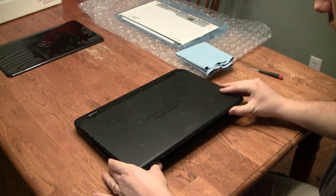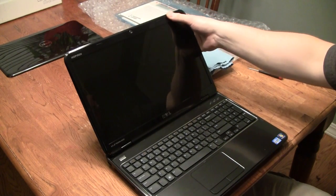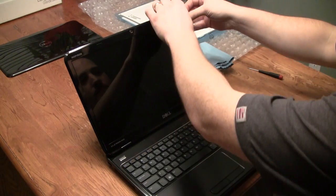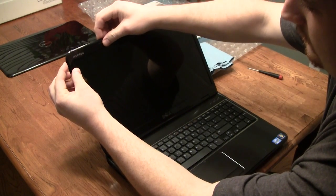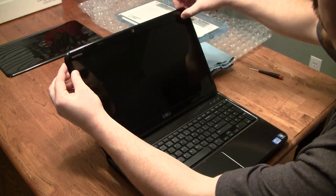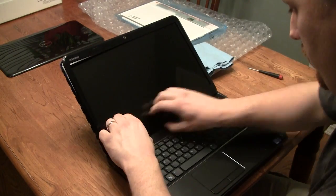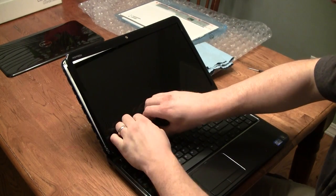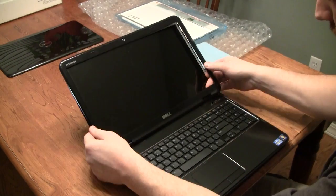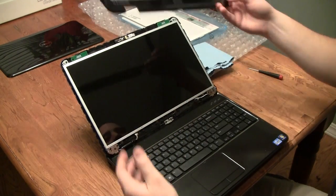When we open up the monitor here, we can begin to pry off the front of the faceplate. You're going to probably want to start in a corner, using your thumb and forefinger, and just apply enough pressure until it clicks off. Go all the way around. At the bottom it's a little bit more difficult — you're going to have to pull from the inside of the screen and it will give. Once you get it free, go ahead and set it aside.